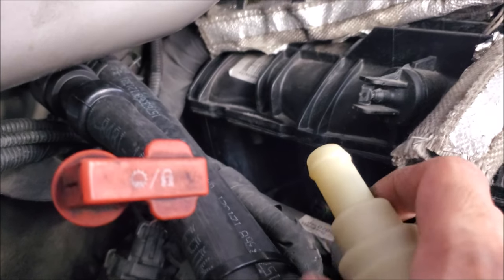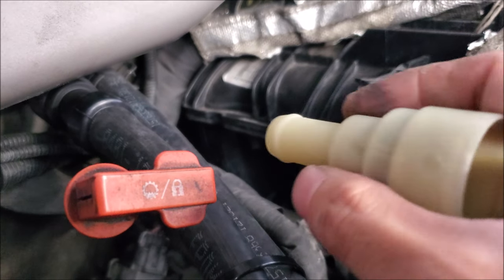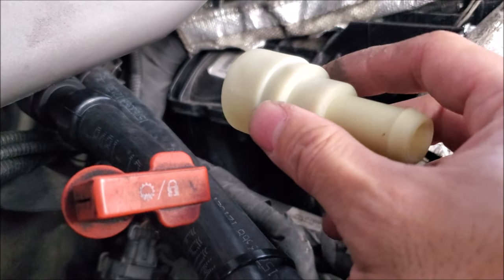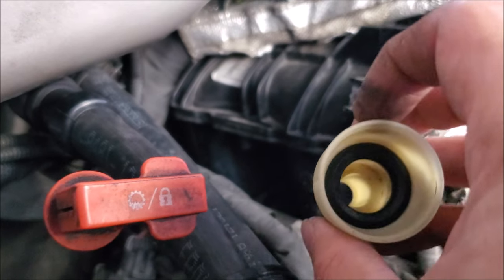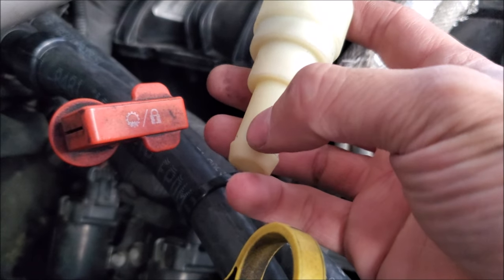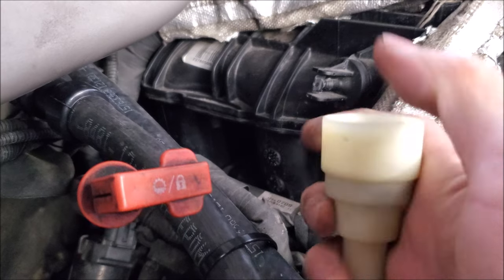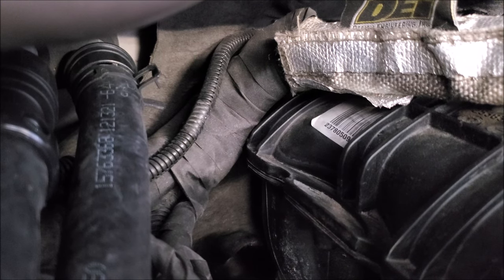I'm not a big fan of these disconnects that GM uses. The first hose slipped on just fine. The second hose, when I tried to click it on and did a pull test, the retainer slipped out of the fitting — it went on and when I pulled to make sure it was tight, it slipped out. It seems the only way it's attached is press-fitted in. So what I had to do is cut the hose as close to it as I could. That self-tensioning clamp comes on the hose on this end, so you have two points of failure. Since the hose is long enough I slipped it on and used a self-tensioning clamp instead — it doesn't leak and now it's only one point of failure.